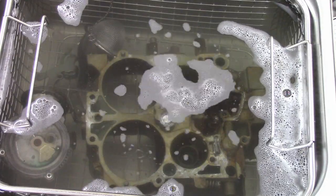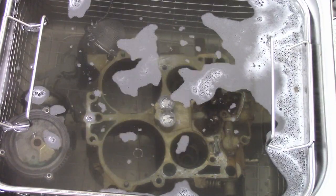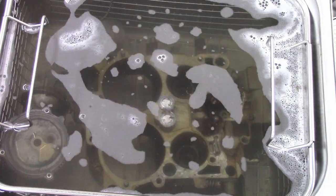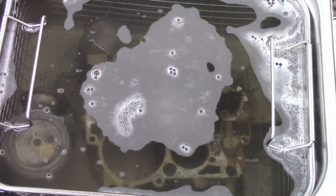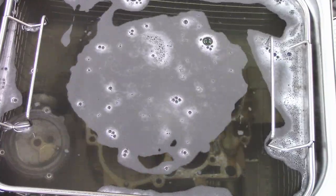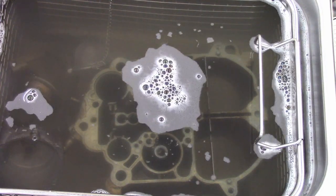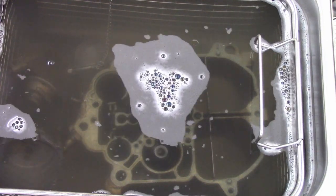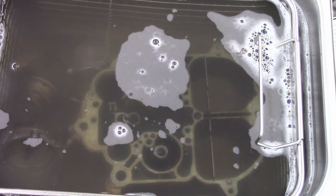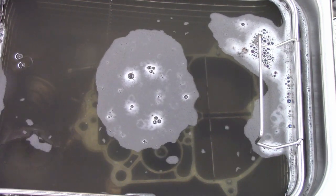That got a little bit too warm for me to put my hands in. Way back when I was a mechanic, we had a big 20-liter pail of carb cleaner. You just put everything in a basket, soaked it in the carb cleaner. It smelled wonderful, stained your hands permanently, and the carb would come out just absolutely spit clean without seeming to damage anything. I have cleaned carburetors with a 50-50 mix of water and pine sol, but be forewarned the pine sol will pull off the protective coatings and then the carb will corrode.